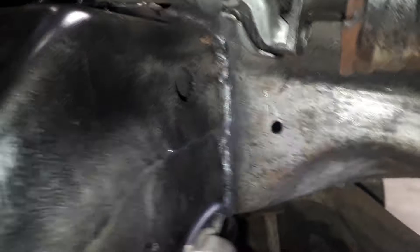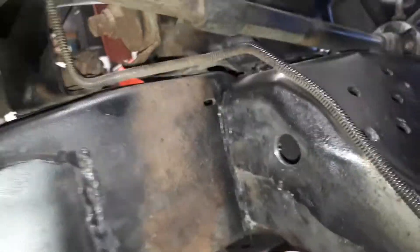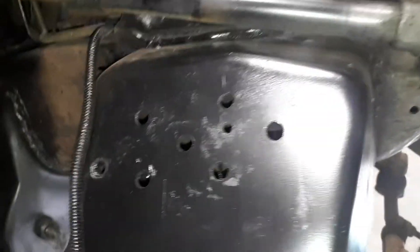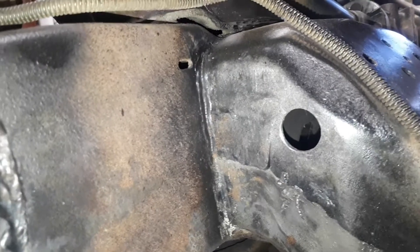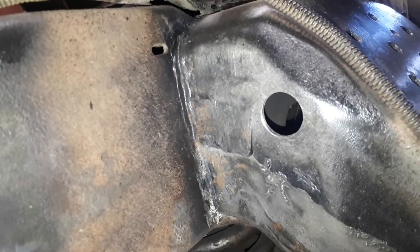On the driver side, if you look here, they give us a little three-eighths hole here on the front, but back here there was nothing - just solid right there. So I figured, seeing as they have the passenger side that way, why didn't they have the driver side that way? So I've just drilled a hole there, which I hope is big enough for my 15-millimeter wrench. At this point I haven't checked that yet - I guess I'll have to check that here soon.